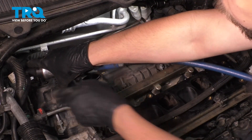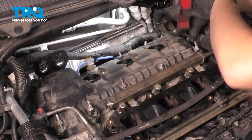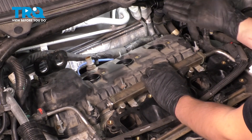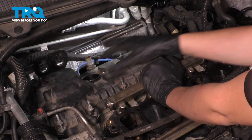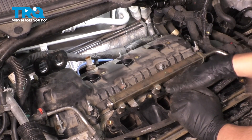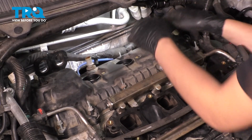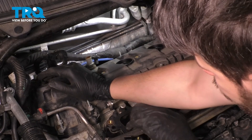There is one more bolt all the way in the middle on the left side, and a little harness retainer that I forgot about. Now with that off, you can lift the valve cover up — it's not going to slide right off because first it's going to be somewhat stuck, and second we have spark plug tube seals and the seals that go around the VVT solenoids. All of these need to slide straight up before the valve cover breaks free. Try to avoid prying on stuff — if you do pry, do it very gently. Be careful what you pry on: you don't want to break the valve cover, damage the fuel rail, or crack the lower intake which is plastic.